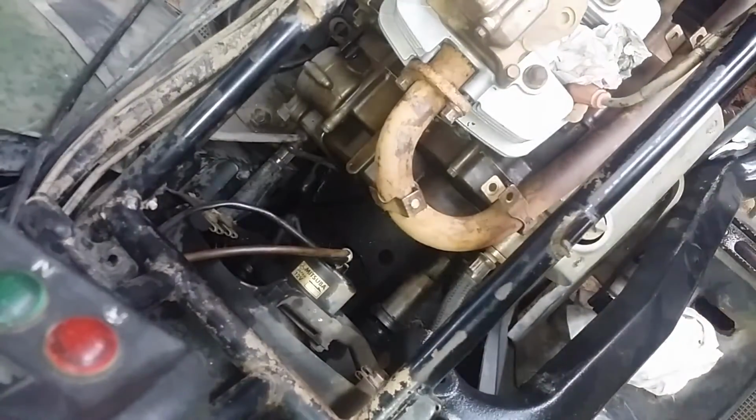Now, mind the clicking once more, we will go down here to this bolt where they connect. Tighten that one up. Something is already extra tight on it, so I guess that's it, because that one's all seized. So I have to get a screw clamp around there and try to tighten that up. But now I'm going to get the heat shield, this piece, and install it over this header pipe, and I will get back to you in a second when I have those fasteners.